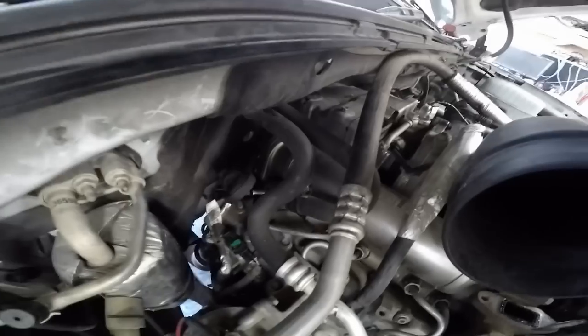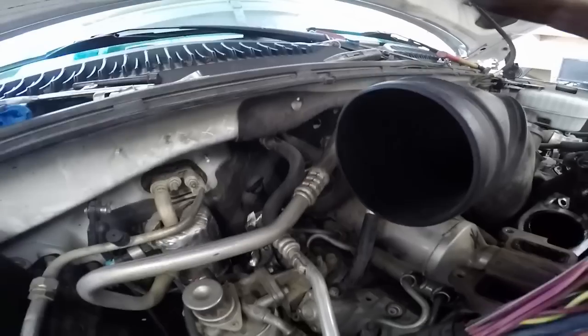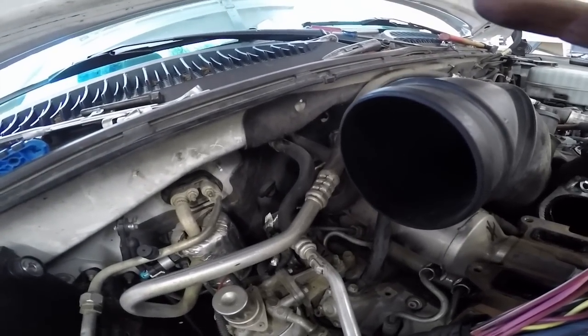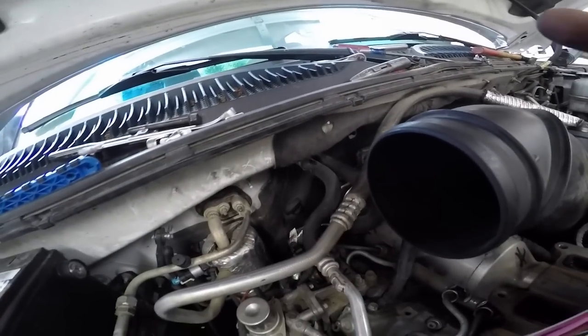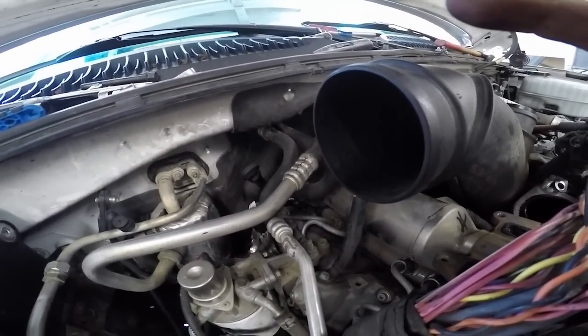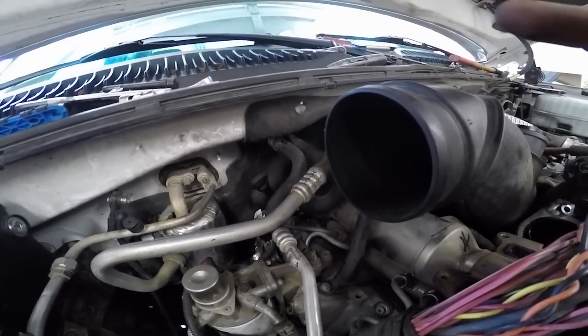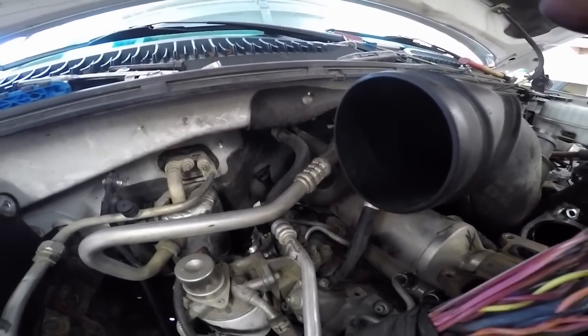The 2 bolts in the very back that hold the exhaust onto the EGR. The one nut in the very bottom, it would not come loose. Skinned up my hand and lost about 3 12mm wrenches down there. Got all of those back, but anyway, I even tried a swivel ratchet, couldn't break it loose. There's just no room to get in there and put any type of torque on it. I ended up using a wrench, a cable, and a slide hammer to get it to finally break loose. But spent probably an hour just on that one nut down there.